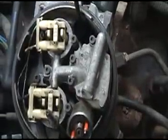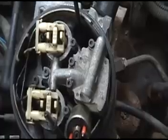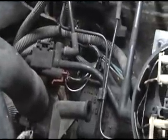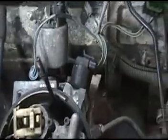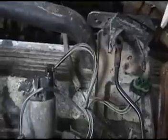Very rarely, but you can have a pressure regulator going bad and just flooding the system. And then the other side of it is going to be your engine temperature control sensor, which is in the very front. Like I said, between these three, it can solve this problem. Let me go ahead and plug this in there, but I just want to remind you, your spark plugs tell the sign.